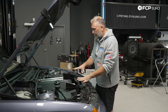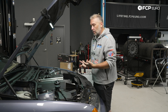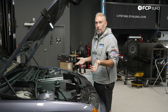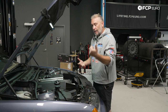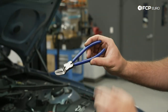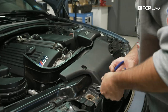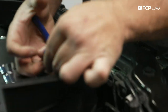First we're going to loosen up and remove part of the fan shroud along with the viscous fan. We need to lift the engine up to get the engine mounts out from underneath the subframe. There are many ways of doing this, including lowering the subframe, but I don't want to touch the subframe because that could potentially affect the alignment. Removing the fan shroud gives us the room we need to push the engine up off the mounts. We start by removing the self-expanding plastic rivets on the shroud.